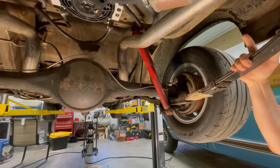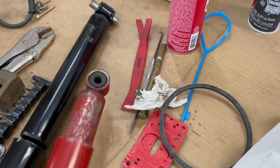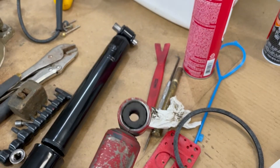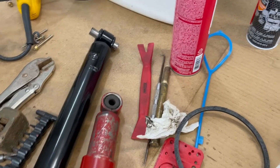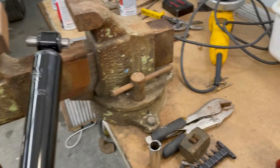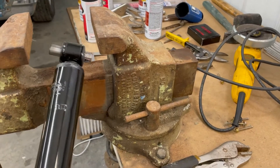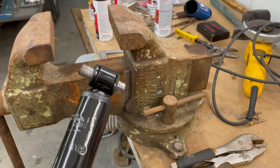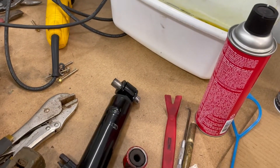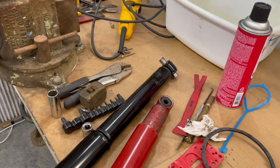I got the old shock on the bench and there's no steel sleeve in this bushing, but the new shocks do have a steel sleeve, so we're driving it out. We're using my new-to-me Colombian vice and a socket and deep well socket, just pressing it through — and it's coming out no problem. We'll get both shocks prepped, get the other one off the car.